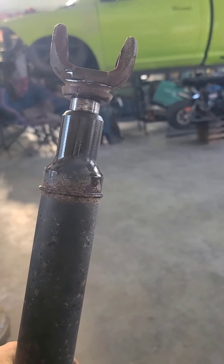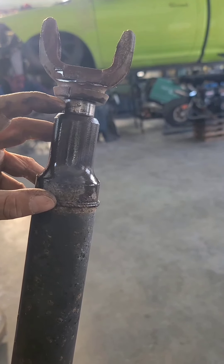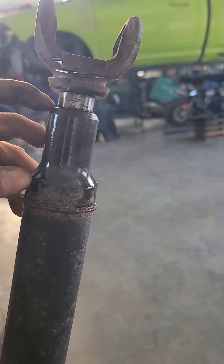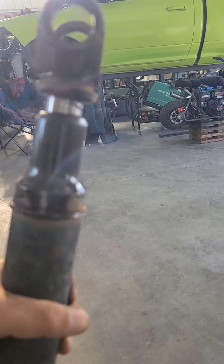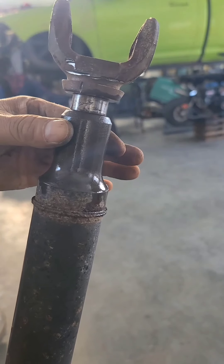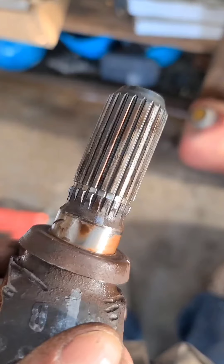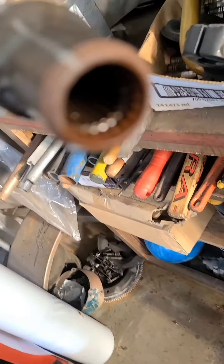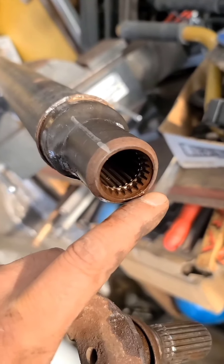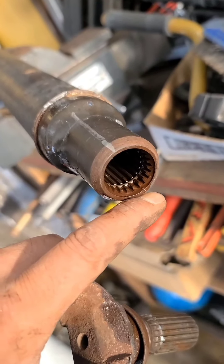There is the end of the shaft — steady bearing sits right there. I cut the mount and the steady bearing race apart with an angle grinder and a chisel. This should be a slip yoke, so it should pull apart, but I'm having a heck of a time because it's rusted and seized and I don't have a press. Got some WD-40 soaking — hopefully I can use some heat and the penetrating fluid and get that freed up and hammered apart. So there's the slip yoke out, there's the splines, and there's a little snap ring inside the end. Once we got it moving it came out fairly easily. I've got to do some research and see if I can get an aftermarket U-joint for this thing before I hammer that new steady bearing on.